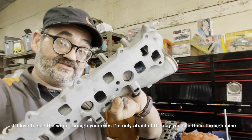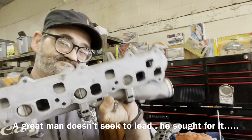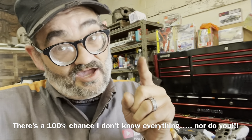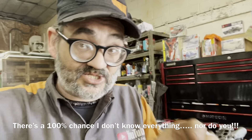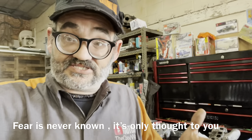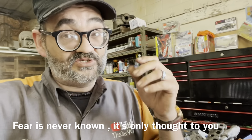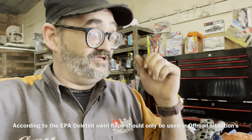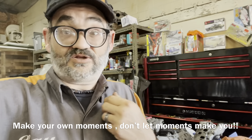I take used intakes, clean them, and put some of my Clayway super slick spray on them to make them somewhat resilient to the carbon going through the engine. Well, I've got an evolution to that process - I've created a situation where you can delete the swirl flaps and still have the engine recognize that they're there. This gives you clean intakes more impervious to EGR carbon buildup, deleted swirl flaps for more top-end torque, better fuel economy, and hopefully never having to take the intakes out again.